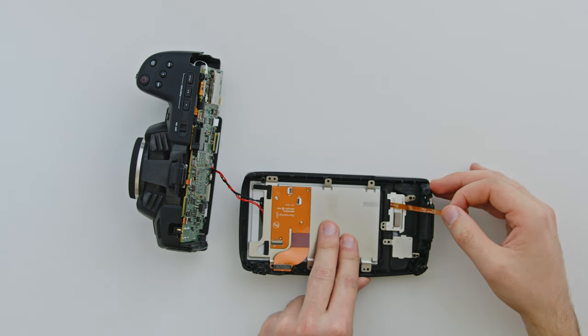Add the other two thinner hinge tension inserts on top of the hinge bar — the display back panel will compress them down into place when we attach it. Place the display back panel with the gap at the bottom for the hinge. We'll use the remaining eight bolts to secure this back panel. When tightening the bottom right two bolts, make sure that the ribbon cable is aligned to its slot and has a little bit of slack, rather than being completely tight, so it isn't being pulled when the display is at various angles. If there is not enough slack, gently pull the ribbon cable from the display side, not the camera side. The lower central two bolts control the tension of the display tilt, so adjust them according to your preference — try to tighten both bolts to the same degree.